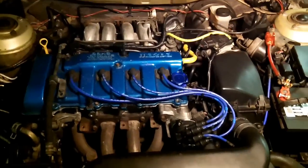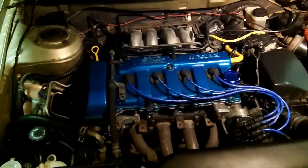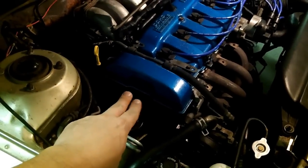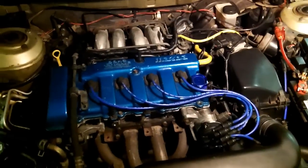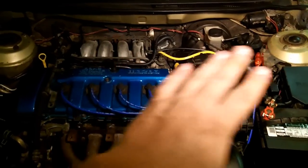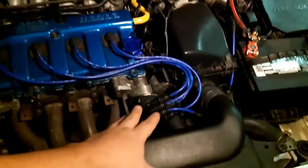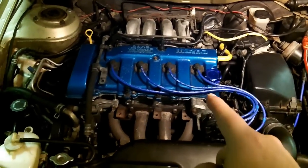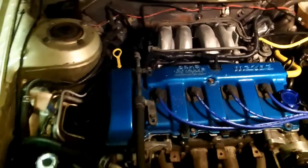Tip number two: for 1998 to 2002 owners who don't have a distributor, it's actually so much easier. The only thing you have to do when checking timing is make sure those two timing marks are lined up on your cam gears. The ECU takes the place of the distributor — it's all electronic. If your mechanical timing is correct, the 1998 to 2002 Mazda 626 ECU takes care of the rest using the coil pack and crank sensor. Make sure your crank sensor and cam sensor are good. On my 1993-1995 car, the crank sensor is built into the distributor, which is why correct distributor alignment is so critical.